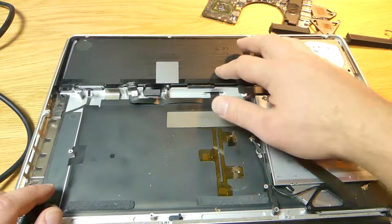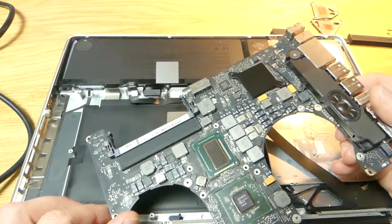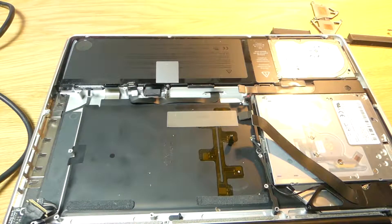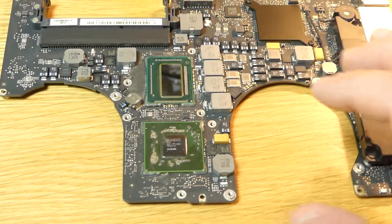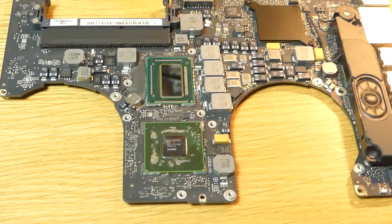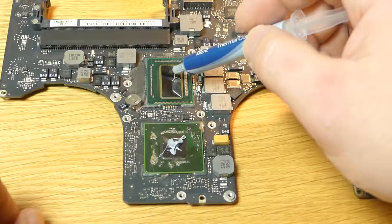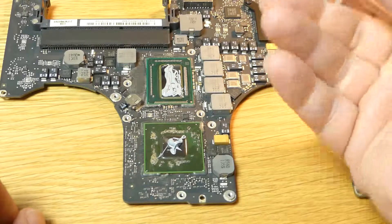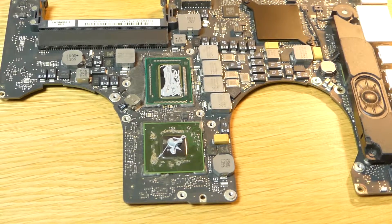And this is the Mac without the motherboard — the battery. Let's start to assemble it, but first we need to mount the cooling blocks. This is where you need the cooling compound, or cooling paste, that gooey thing you put between the CPU and the cooling block. It's to make an almost perfect connection between the top of the CPU and the GPU so it really comes in contact with the cooling block.